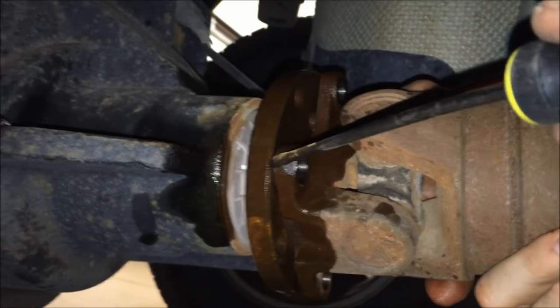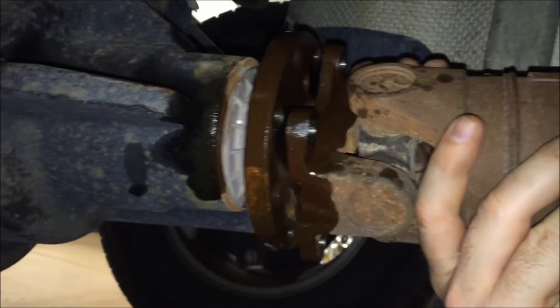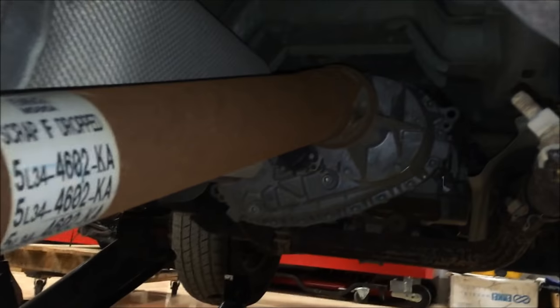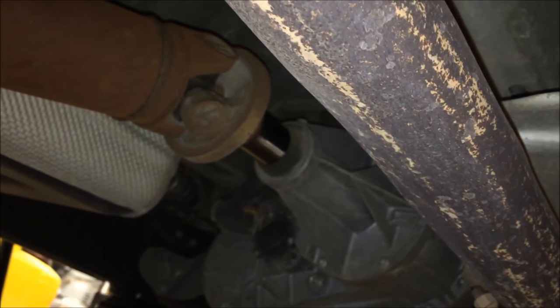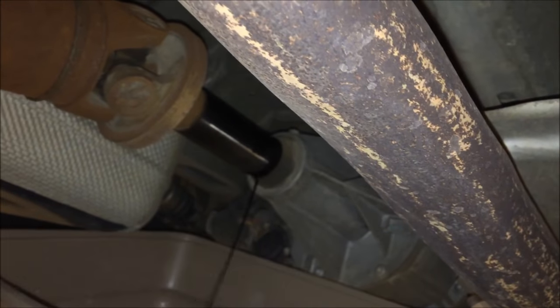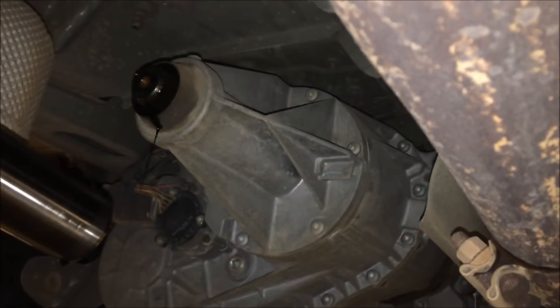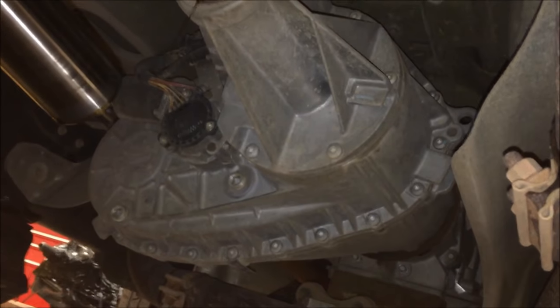Go ahead and pull forward on the drive shaft. Sometimes these are pretty stiff and there's not a lot of play. We went ahead and put some Liquid Wrench all around this because it was stuck up in there pretty good. Once you have the bolts out you may even need to get a screwdriver in here and hit it with a hammer to separate it, but after that you should be able to pull it forward slightly and then drop it down. You're going to want a catch pan because as soon as you pull the drive shaft out of the transfer case you may lose some fluid. Just pull the drive shaft straight out — and remember when you're filling everything back up to refill the transfer case and the transmission fluid.